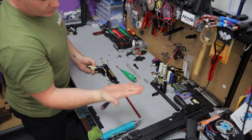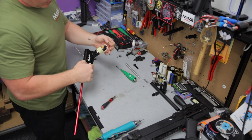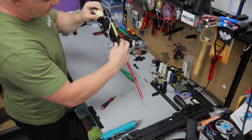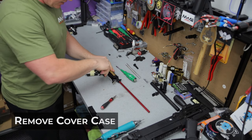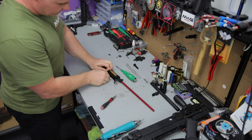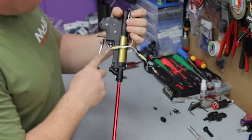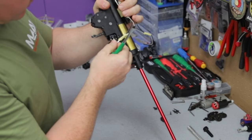You've got your two screws, and then on the opposite side you have got your two little nuts on the sides. Place them - they will either stay in or fall straight out, don't lose them. Once you've removed the motor, you've then got all your wires going to your switch, so you're going to have to remove your little case there. I'll use the razor blade - it just slides in a little bit easier. Pushing in, clipping up, put that blade away - safety first guys. Move your little cover - that's going to allow you to see your little switch inside here. Then simply get your flat blade screwdriver in there, lever that one up, you can pop underneath the terminals there, pop it out, done.